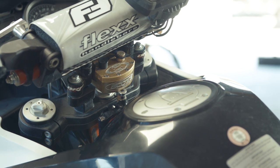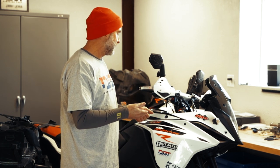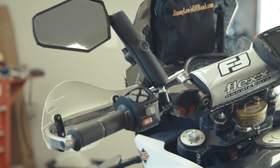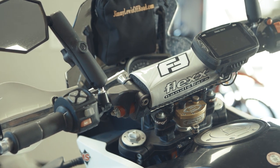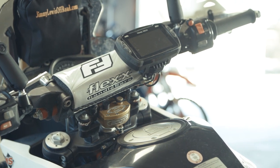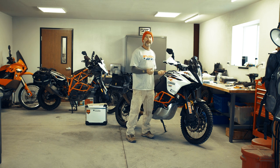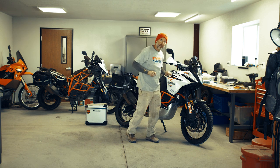With the BRP mount and Scott's steering stabilizer sub-mounted, you get about three-quarters of an inch of standard bar rise. I'm pretty picky — on one of my bikes I actually had the BRP mount milled down and dropped everything a little bit lower, then used the standard height flex bar. They make a lower bar too, so I was able to manipulate it so my two bikes have slightly different rises, and I notice the difference. Most people think they need taller bars, but I'm not like that — taller bars tend to push you back, and I want to stay forward on the motorcycle.